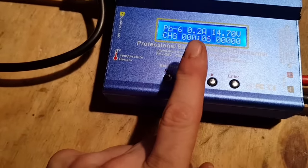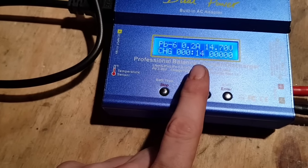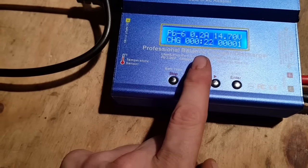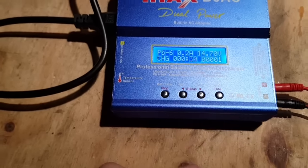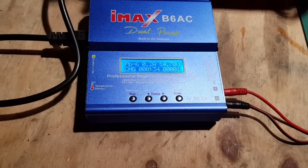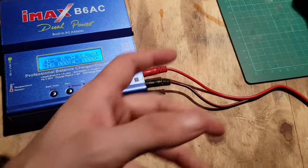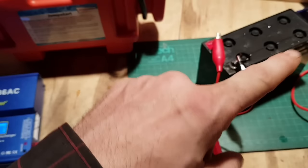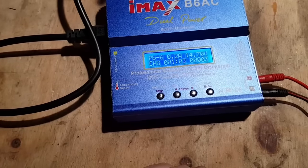See how the amps have shot up now — to three, back to two. It'll go to three and maybe four before the 25 seconds. I think this will start charging now. See how it's 26, 27 — that's it guys, the battery's fixed and already cycling. So I'll let it take its two-hour course, take it off, let the battery chill, open up the caps again, and see if the cells need to be topped up with water. If so, I'll just rectify that and stick it back on another charge.